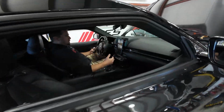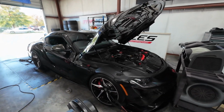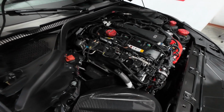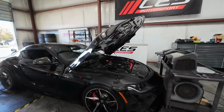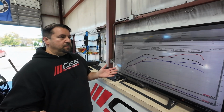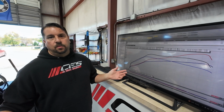The temps also play a role, but the biggest factor again is the Do88 intercooler, the Mera intercooler with the Garrett core, which is just doing the work. While we were doing these pulls, especially beforehand when it was cooler in the evenings, the IATs would actually drop during the dyno run. So we would start at like 79 ambient and be at 75 degrees by the end of the pull. Even for these particular runs, ambient temp was about 75-ish, and it was literally staying the same the entire pull in 5th gear.